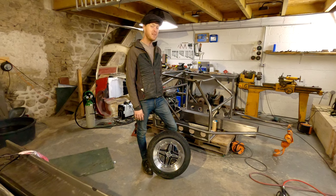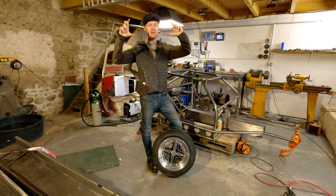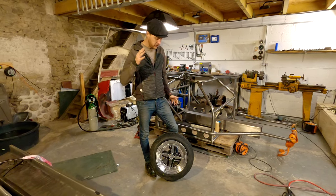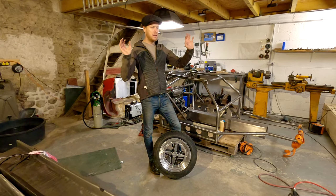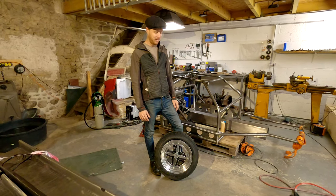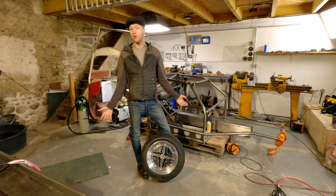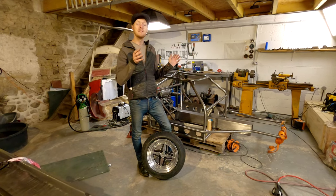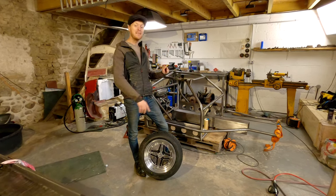It keeps quite a sturdy sidewall, so it's a really good way of having a large sidewall while keeping it stable. If you go for 13-inch wheels you'd have to go very very wide, and that gives you a sausage-shaped contact patch. Whereas if you go for a little bit more diameter, it gives you a square contact patch. If I'd gone for a 15-inch wheel, which would have given me loads of tyre choice, it would have looked stupid. A 185/50/15 is exactly the same diameter as a 2CV tyre, so I was checking diameters.